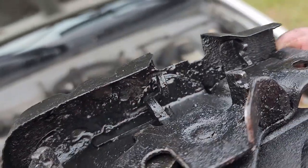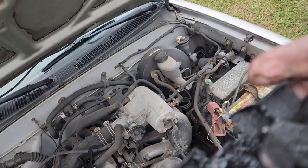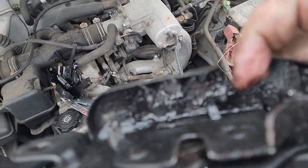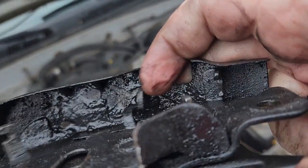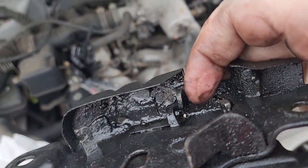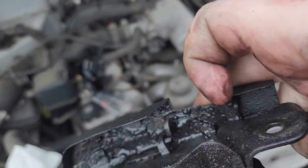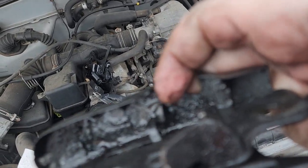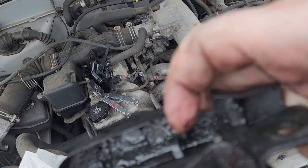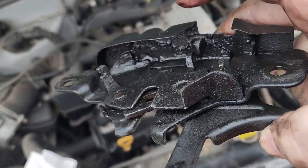You can look on the new one, but I'm going to show you on the original as well. You see how this section has that twist — there's a little bit of an opening. This right here is what that ball on the cable will clip into. What you do is get yourself just a little bit of slack in that cable. I found it easier if you pull it loose from the back first — just take something and pop it right out of there. Then on this section, push that ball forward a little bit to where it's sticking through, and then just flex that cable down and lift it right out of there.